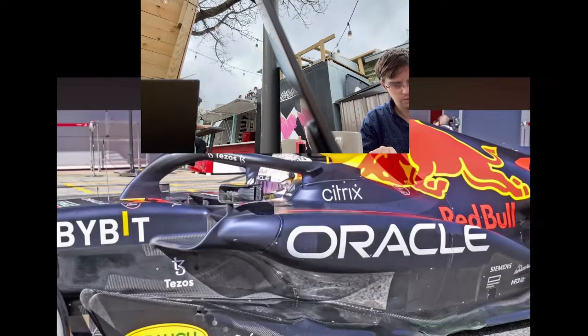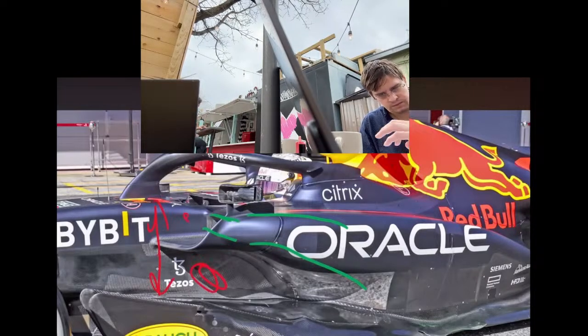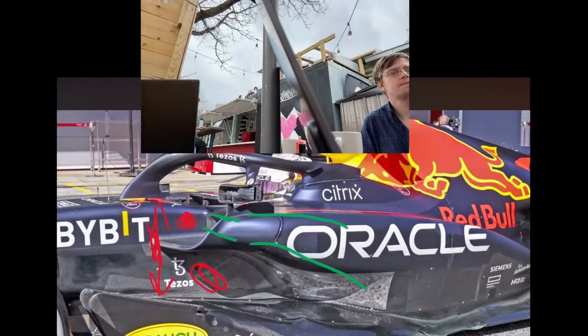The next one is tunability. Now let's say that I have a certain inlet and ducting characteristic. I don't want to be playing around with that too much, but let's say that I want to have really good tunability at the front so that I have the option to go either leading edge up or down on this region to maybe get more pressure here or more suction here, or maybe the other way around. We want to pressurize here a little bit more. So I want to have some flexibility in how I tune this particular region. If the inlet is decoupled from the forward edge, which we've done here, it means I can leave my inlet more or less fixed and just play around with moving this leading edge up and down, as well as playing with other bits of geometry and curvature in this general region. Now this is actually a very useful characteristic from an aero development perspective, because let's say you do a change upstream, you can quickly adapt this particular portion of the bodywork to match whatever flow changes you've made.